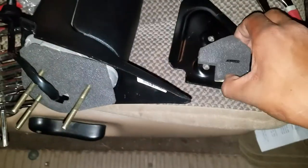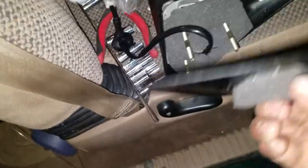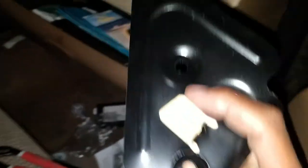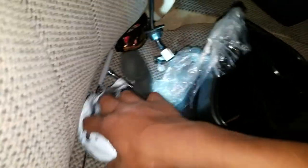Don't mess with that part — just leave it alone. You'll want to punch a hole through there, like with a screwdriver, so you can thread your wire through. You can see how I did it on this one. The plate lines up with the door panel — have someone hold it up or hold it yourself while you line up the holes and thread the bolts on. Tighten those with a 10 millimeter.